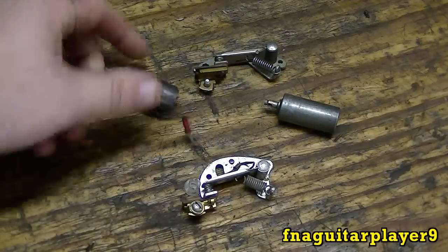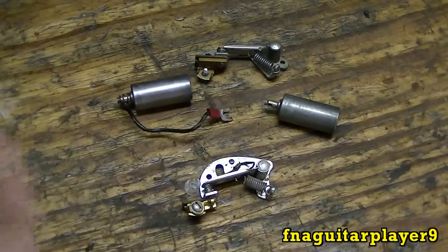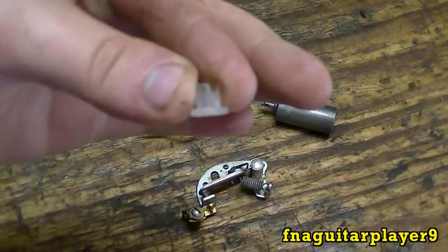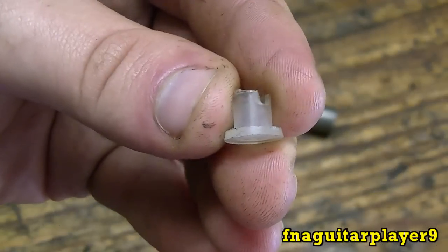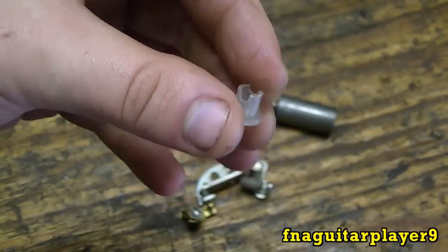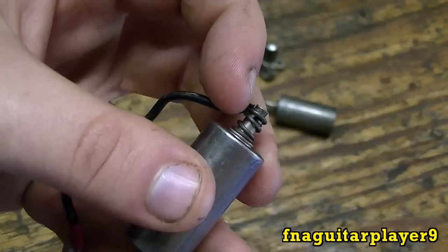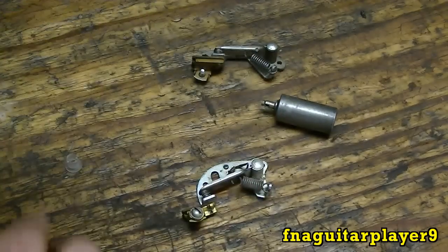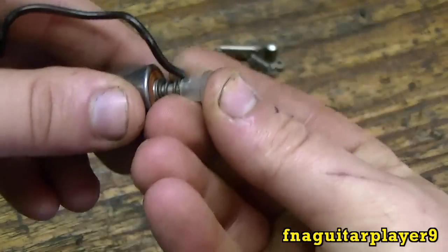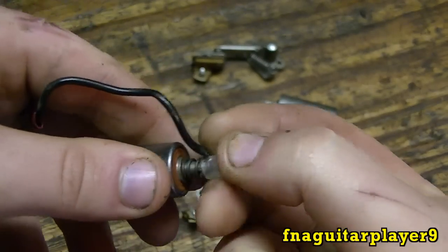You could also have a bad condenser. All a condenser is, is a capacitor — that's all they are. When you buy your points and condenser, they'll come with this little piece of plastic right here. This is a tool for installing the wire on it. As you can see, the wire has a spring on there, which is what holds it. You squeeze this tool to compress the spring to get the wire in or out.